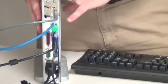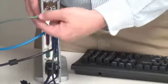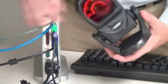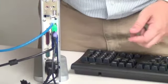We're back here on the back of the Neoware. If you notice, you've got several things plugged in. The first one you may or may not have is a simple scanner — that's what this first cable is. Let's go ahead and unplug that; we're going to need to plug that back into the new device. The next one is your network cable. Go ahead and disconnect that — it may have a boot on it, like a big phone jack, so push down and pull it out.